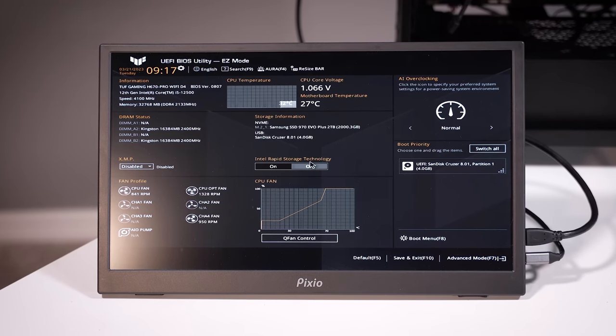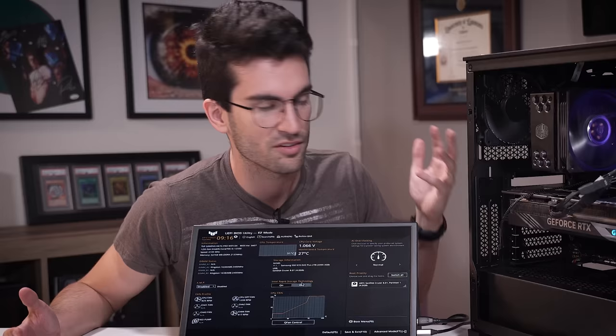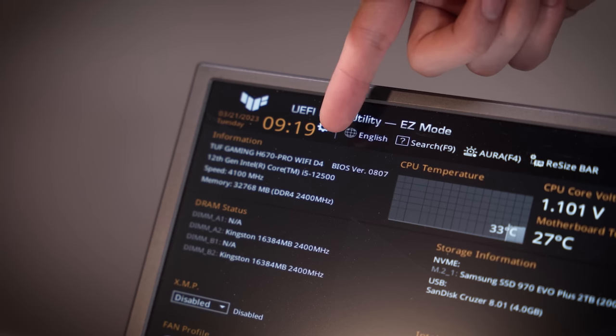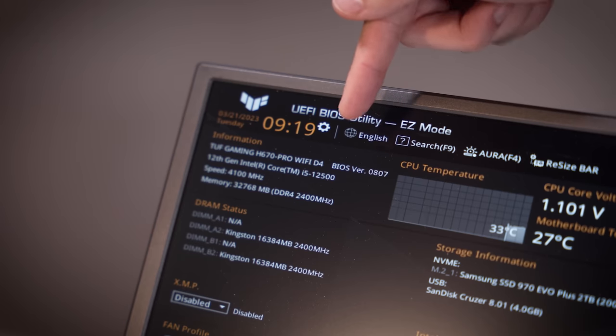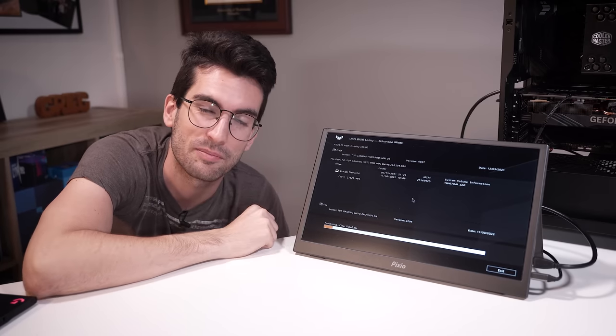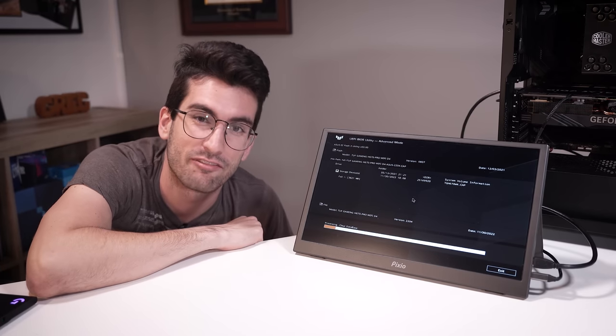It looks like every other component in his rig is working. We would expect all of that stuff to work because it's all brand new. And sure enough, this BIOS version is far too old to be supporting 13th gen Intel, so our suspicions have been confirmed. Now, I know I say this all the time, but while this BIOS is updating, please do not turn the system off. It's not gonna be a fun time.